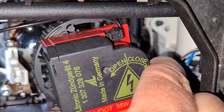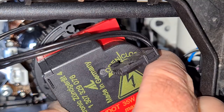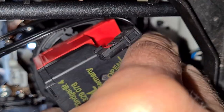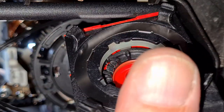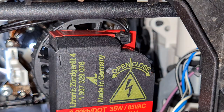It's amazing — I wish I'd known that when I did it the first time, because I spent hours trying to get it on with the connector in place. These things are held on by just a few clasps, so just wiggle it around — don't put any great force on it. It's these four legs that click into holes on the ring. Make sure the loom doesn't get underneath it, wiggle it around, locked into position, and put the loom back in. That's bulb and igniter changed — no problem at all.